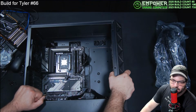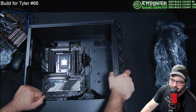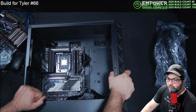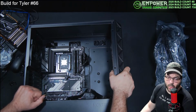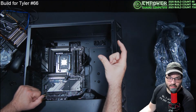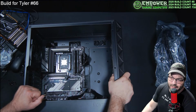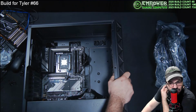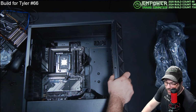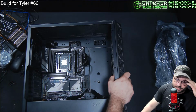No Wi-Fi button. So I'd recommend... what motherboard was it again? Sorry. But I'd recommend, if you have another computer, Joe Schmo, go on that computer, use a USB drive, download your motherboard Wi-Fi drivers, move them to the USB drive, take that USB drive, put it in your new computer, and install the Wi-Fi drivers from there. That is what you're going to have to do to get past this. Or you can get a newer Windows 11 installation that would include the drivers.